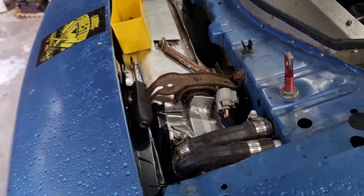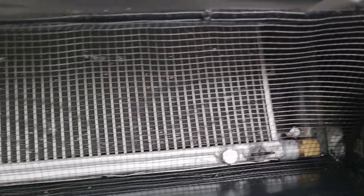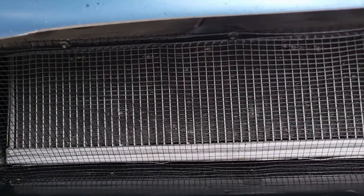Then it goes all the way back to the front and comes back in through the heat exchanger at the front — the front radiator there, which is almost exactly the same size as the main radiator except it's quite a bit thinner, like one inch. It's a decent size. With the radiator ducting, it allows for expansion of air to the entire face of that radiator. I've also opened up the main radiator a little bit, so hopefully it should do pretty well. System is now sorted.